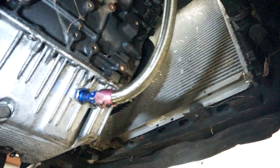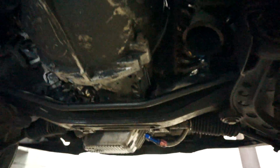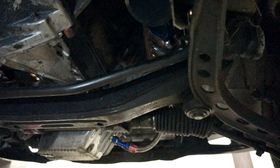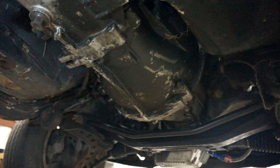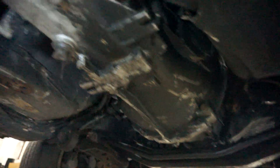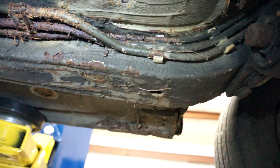It just drips — it's not terrible and it doesn't really leak any worse when it's running. So we're gonna pull this turbo setup out, and I think what's gonna happen with this chassis is we're gonna leave the engine and transmission in it and probably turn it into a rally car. That's why I want to make sure this transmission is still good — this is a Getrag 250, it should be fine for rally use. It's got E21 mounts back here and E34 — I think M5 or 535i — motor mounts up front. These lines are all rusty and nasty, they need to be replaced, and that top one is my brake line for the rear brakes, which I've already had one failure of.